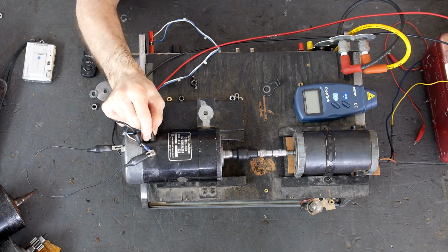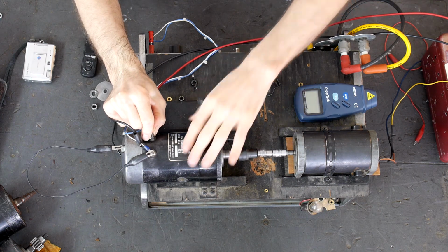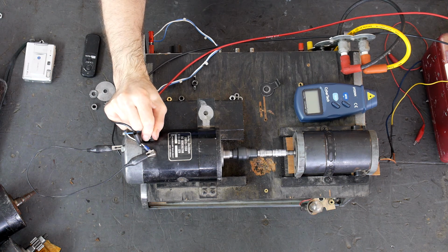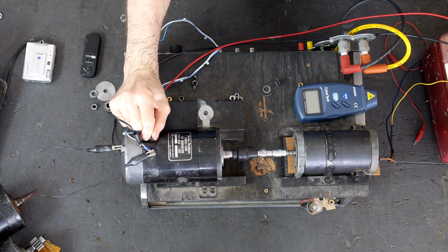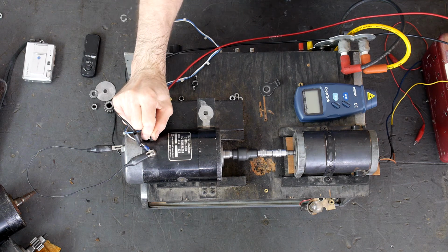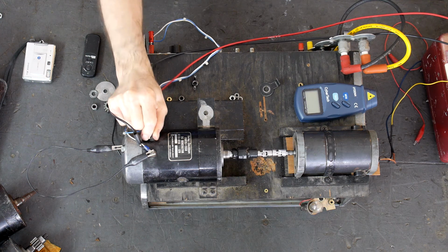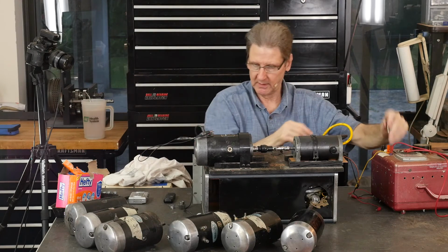Right? Can you see that? I guess my hand's in the way. It feels smooth, it sounds smooth. It's not a lot of drag because I don't have the clamp set up in this one. It won't fit for these bigger generators. I see the current is nice and steady, 6, 7, 7.5, 8, about 25 volts and 8 amps, I would say. 25 volts and 9.2 amperes, smooth as silk. So let me go hook it up again the other way. How long would that take? Let's see, this thing could come over here.